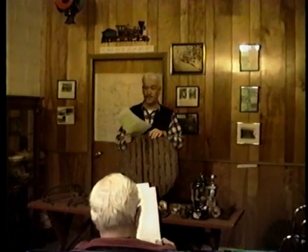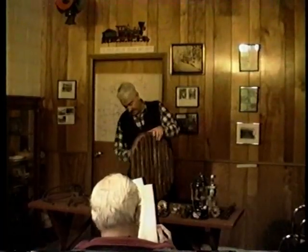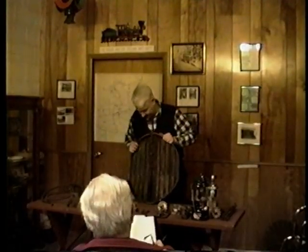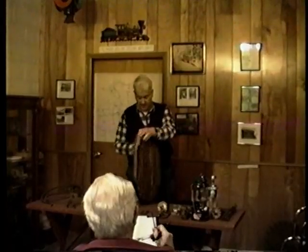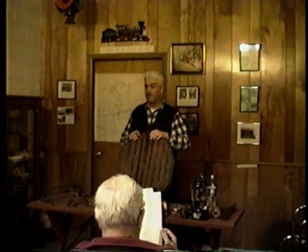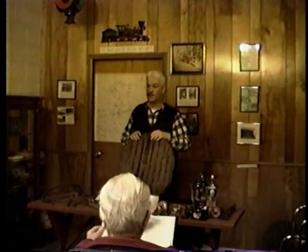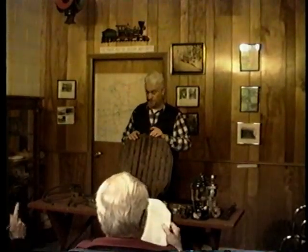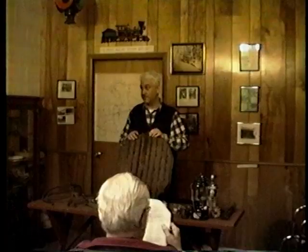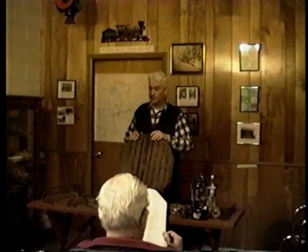We're learning that there was a problem in there. I mean, we put up with it, and finally we got the time and took it apart. But look at this, you can see it from the back, see how big that crack is? From here to here. I trust you can still find those things. Well, see, this is an unusual thing. That's a 1914 10 horsepower car, which has a 20-inch boiler in it. And they only made 20-inch boilers for 1914 cars. They were trying to find a 20-inch burner. This is a 23-inch burner that was put in there because they couldn't find the 20-inch burner in 1946 or something when they bought it. So this has been in there for 50 years and worked pretty good for 50 years.